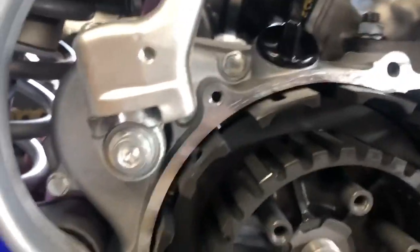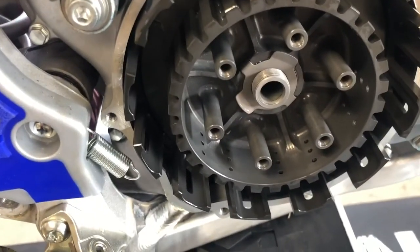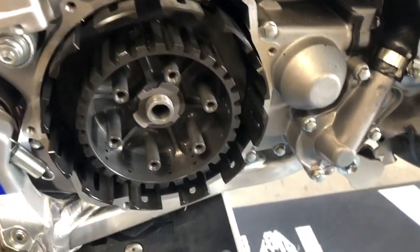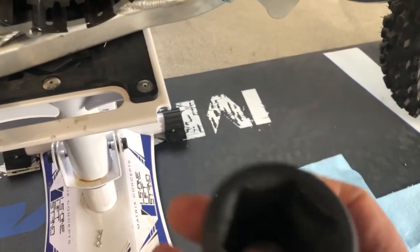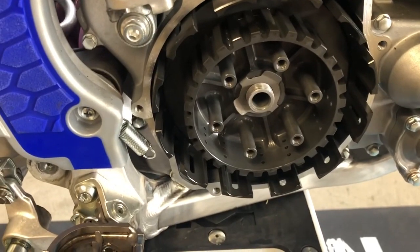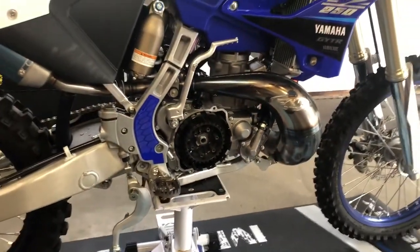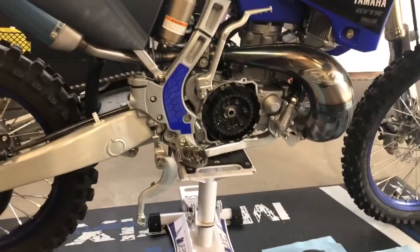You can see that these wing up so that you can fold it onto the bolt. Remember, we have a 29 millimeter socket that you have to use. So we're going to put on the nut and torque it down to the specs provided by Yamaha. I'll get this going and get back to you, but that's what it looks like so far. You can see we're running out of parts, which is a good sign. So let's get this thing back together again and see how it runs.